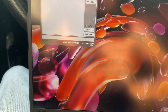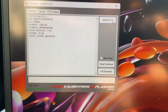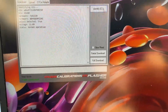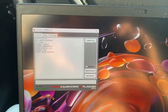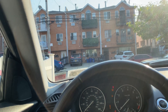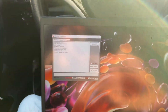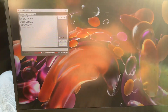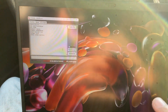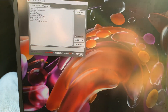Now we're going to come here and click Identify ECU. It's identified my ECU. That's my ECU right there and the voltage is detected — everything is good. If this is your first time tuning, you're going to do a full download of the ECU, and then you're going to send that off to get your tune done. Once it's plugged in you just click Full Download and leave it. This is very important — especially why I mentioned having the trickle charger. I think my full download took about 45 minutes, so you're just going to want to leave it.